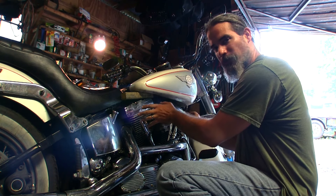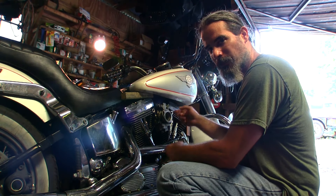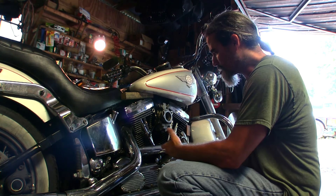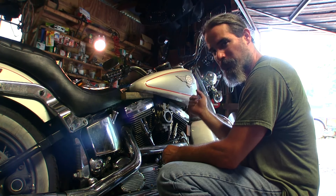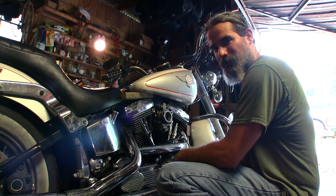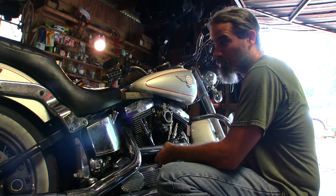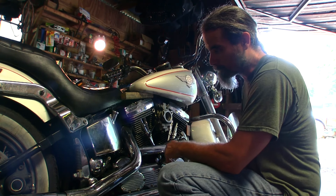It's got the perfect drivetrain, it's got the perfect motor. One of the things I'm doing right now is changing out this carburetor. It's got a Mikuni carburetor on it, and Mikunis are pretty much known for one thing only — performance. I'm not much about going fast, I just want to cruise and ride. This carburetor makes the bike real sensitive, and it only gets 29 to 30 miles to the gallon. This bike ought to be getting about 45 miles to the gallon. This is not the carburetor that came on this motorcycle — what came on it was a CV carburetor.